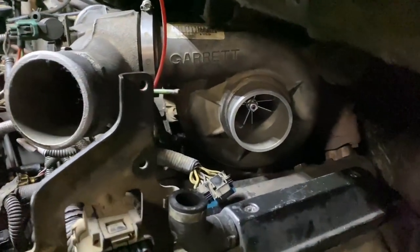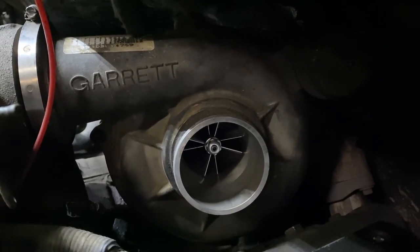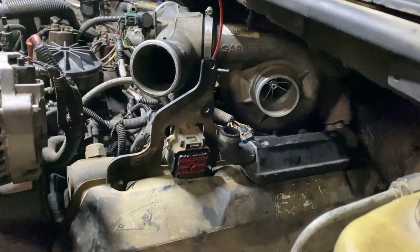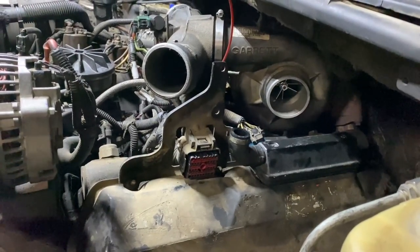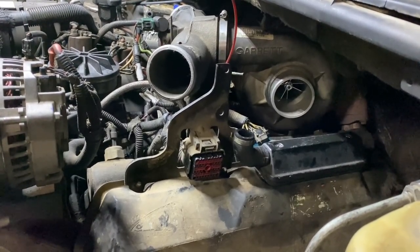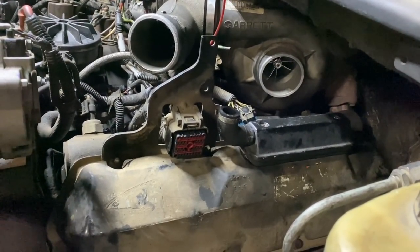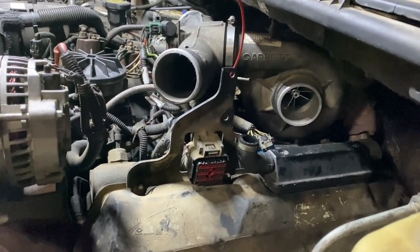Something else I didn't show y'all the other week - I got a Riff Raff compressor wheel in there, the four blade, and that thing is amazing. There is no surge anymore at all. The turbo is making about three more pounds of boost, but the biggest thing is when you're going up a hill and it's lugging the motor a little bit, like 1700-1800 RPM in overdrive, it starts climbing a hill and will make some boost. Now instead of the turbo surging and stalling, those four blades let the air back into the box - you can hear it get louder. Used to that's when the surge would happen, but now it doesn't surge. It's nice and smooth. It still makes good boost and it pulls on up. It's got to be better on the turbo.